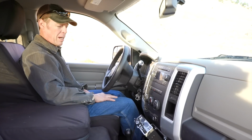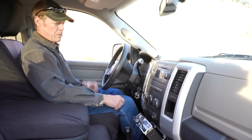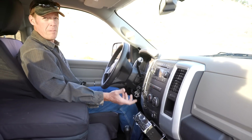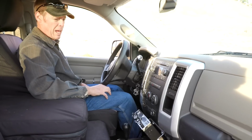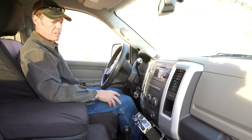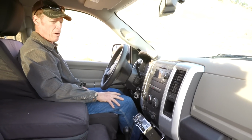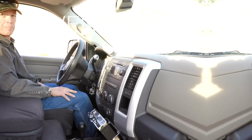The other thing that I did is I completely disconnected the smart bar setup, and I put an EVO manual sway bar disconnector on it. I actually have to reach under the bumper, and there's a little screw you turn in and out. So now I have manual switches for the lockers, and I have a manual switch for the sway bar, and I'm totally happy with that setup.